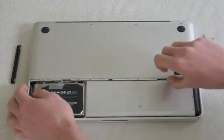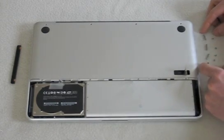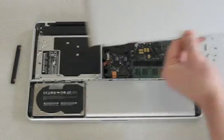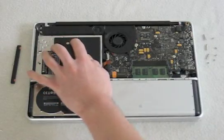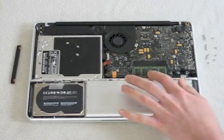I'm also going to show you guys how to replace your RAM. You want to make sure that you remove these eight screws here. I have set them in an order so that if you pick them up, you would basically be able to set them in like this. Simply lift up on the panel and it will remove fairly easily. Now you can see the entire inside of your computer — you have your SuperDrive, your fan, your motherboard, and all of your other boards, as well as your RAM slots here.